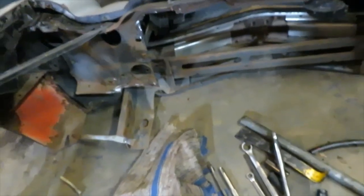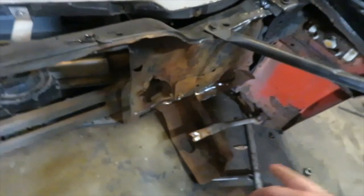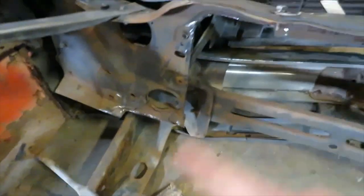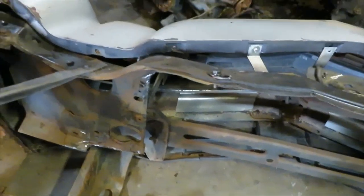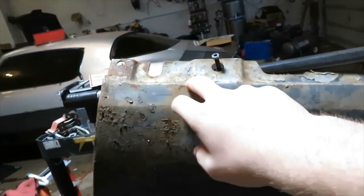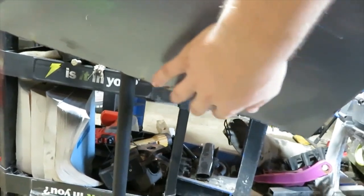The core support is cut and hacked everywhere because we cut it off - when you lift the front end up you can't have your radiator lifting with it, so we solid-mounted it. The hinges we're going to use are the factory hood hinges for this car, but we're going to mount them to the bumper and weld braces all around the bumper so everything's solid. These fender rods are going to be welded to it to keep the fender straight. The bottom halves of the fenders bolt there, the top half tilts up, and I'll put weather stripping there to keep it from cutting you.